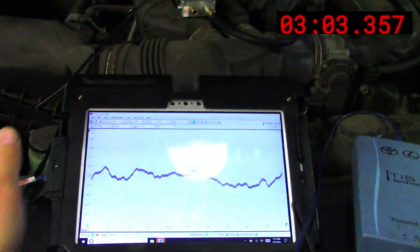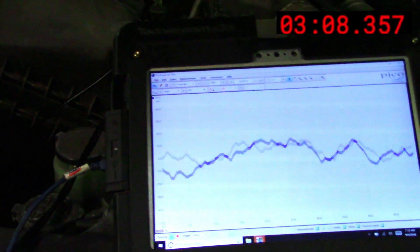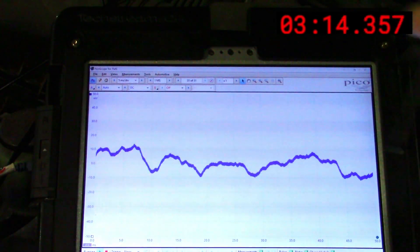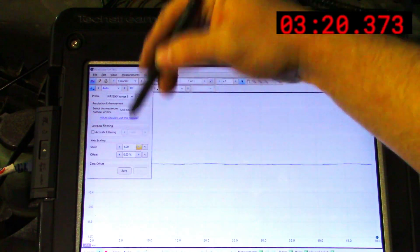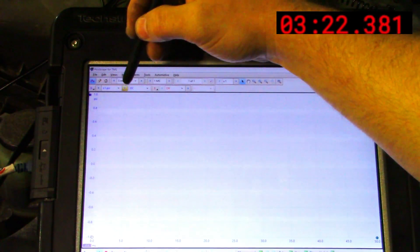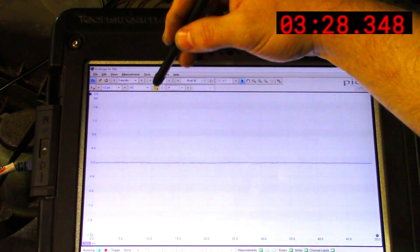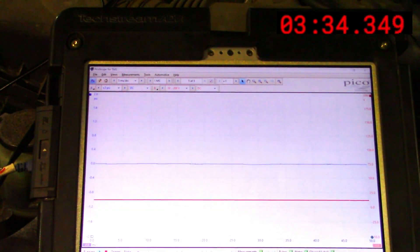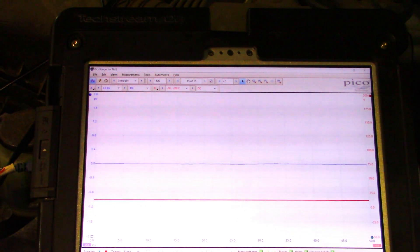I'm going to use this drop-down menu, click on the A, click your probe, click on WPS range 3. I'm just going to take it to say 2 PSI — should be enough. And then on B, I'm going to use a 20 to 1 attenuator with 200 volts. Just like that, my scope is hooked up. Probably took 2-3 minutes, and that's while talking to a camera.